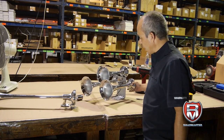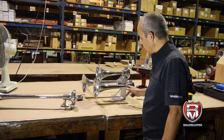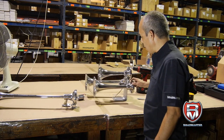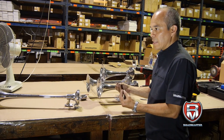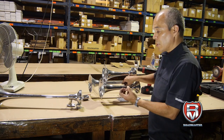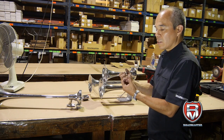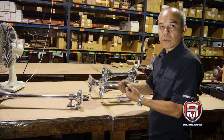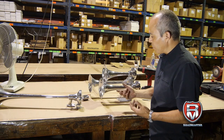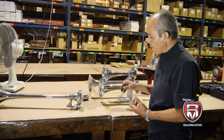The only thing that can go wrong with an air horn is if you don't clean and maintain them — the passages can get clogged and that will cause the diaphragm to break. Another thing that happens with compressed air is it creates condensation. So if you don't use the horn for some time, condensation will cause the solenoid plunger inside to get stuck, creating corrosion. Make sure you blow it out every once in a while, keep it clean, and make sure all the ducts inside are clear.